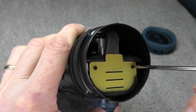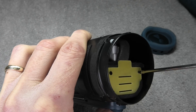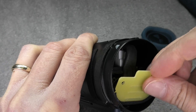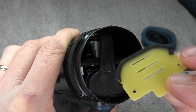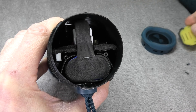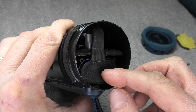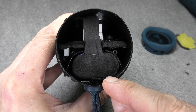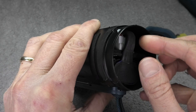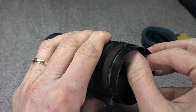When you look inside you'll find this yellow plate held in place by two small Phillips screws — let's remove those. As soon as we take off this plate we can already see the battery right underneath. We do have two small problems getting this battery out: first, the battery is sitting in there pretty snug, which makes it tricky to remove, and second, we need to detach the cables that go to the motherboard.